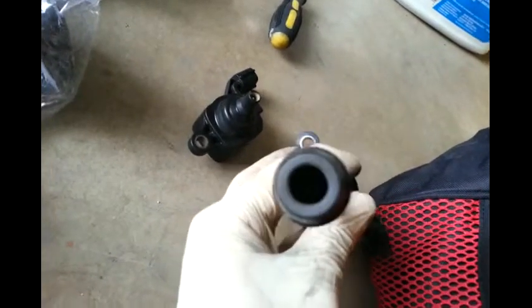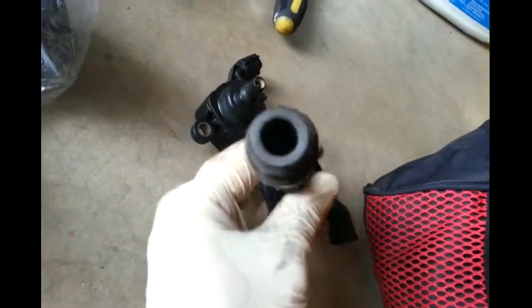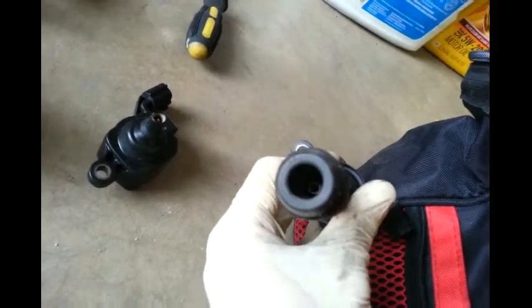So I'm going to pull the boot out. See here - looks good. There's no oil or anything, so that means my seal is working as it's supposed to be. So I'm going to remove here. Alright, I pull the boot. And look at this - you see it's pretty bad. I hope you can see the cause. You can see that it's rusted up pretty bad - the connection here. I hope this is the culprit, but let's see.